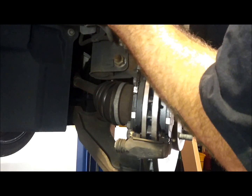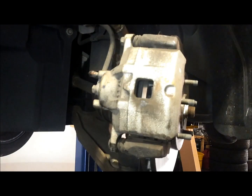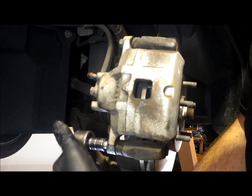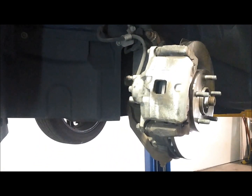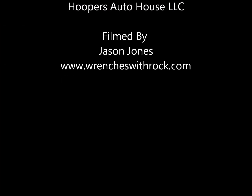Now I'm going to push the piston back in on the caliper — compress it and slide it down. I'm going to slide everything back together, take my greased bottom slide pin and slide it back in, twist it in by hand, and tighten it down with my Milwaukee electric ratchet, which can handle 150 foot-pounds manually and about 70 foot-pounds electronically. I'll also grab my hand ratchet and make sure those two bracket bolts are snug, then finish up with a breaker bar to make sure everything is properly torqued.